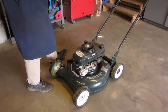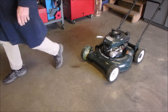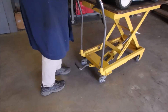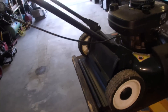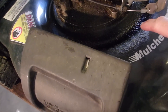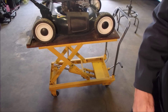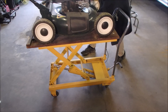So we're going to put it on the stand right away. It's throwing oil — it's not leaking oil. Come with me, we'll turn on the bright lights. Look at this side over here — it's completely scooshed with oil here. That's a new word, eh? We'll have to investigate that — that's more important than the tune-up. Let's get a light and see where the oil is coming from. The air filter's fair. I think the oil is coming through that hole right there, coming down through the frame.